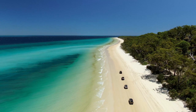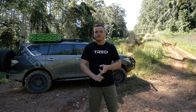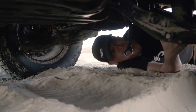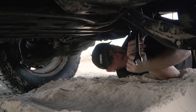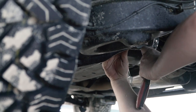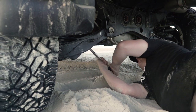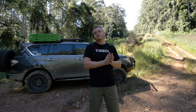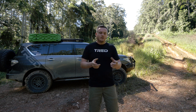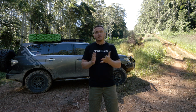As cool as this car might be, it does have its limitations and a few things frustrate me. The independent rear suspension is soft on road, and I have constant issues with knocking the wheel alignment out. After a couple of tough tracks, hitting a couple of rocks, I quite often find my rear wheel kicks out. I'm getting extremely good at doing rear alignments on the side of the road underneath the car. The other thing is sway bar links — because I ripped out all those hydraulic lines I had to put sway bars in to make it legal. Under all the load and weight of the vehicle I was snapping the sway bar link ends, so I upgraded them to heim joints. So far, so good.